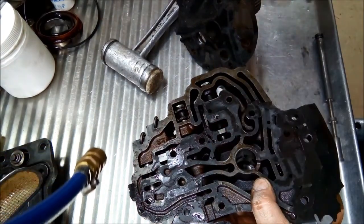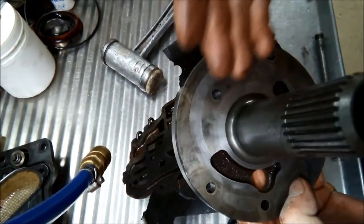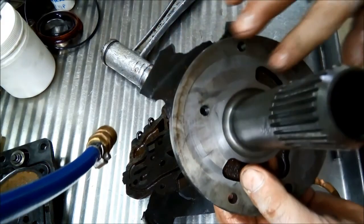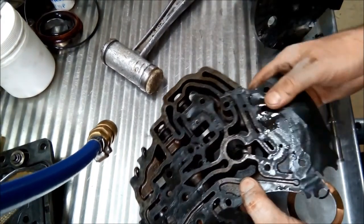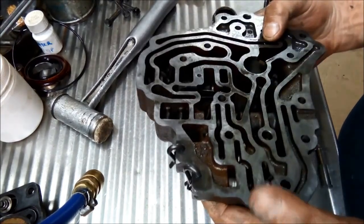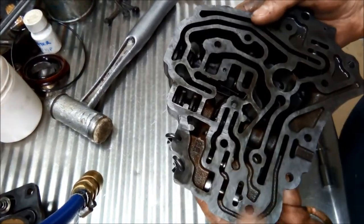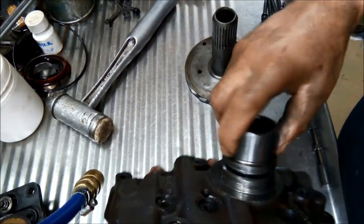Tapping the stator shaft off - not hard, just enough. Now cleaning up all these gasket surfaces, running them over with a stone to make sure those surfaces are nice and flat. This surface that runs on the opposite side of the pump also gets smoothed up with a stone. Scraping all the gaskets off, blowing it all out, trying to make sure there are no little bits of gasket stuck anywhere.